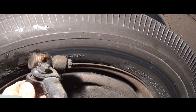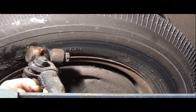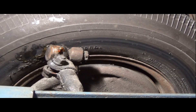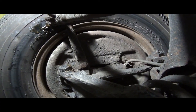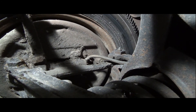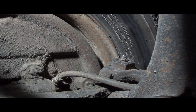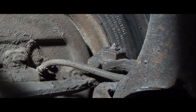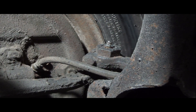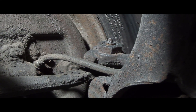I don't really do a lot of suspension work, so I'll have to sort out whether this is a matter of just loosening it and pulling it back in a little bit. There's a pro and con to everything, but that's something to be investigated a little further. Tie rod ends are at least lubricated — a little disturbing about that one rubbing against the tire. Moving on — there is a steering knuckle bushing right there with a zerk on it. I'll get that one and the other one up front, and that'll be a good start on some of the steering lubrication. Then we'll call it for the evening.